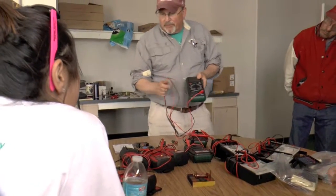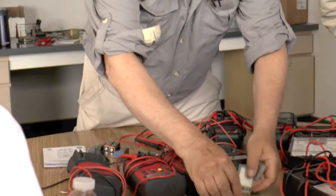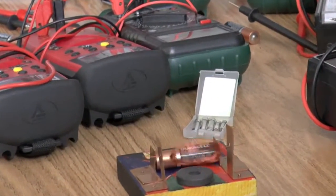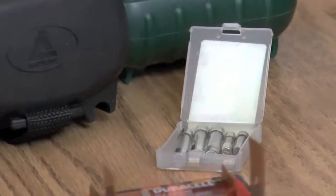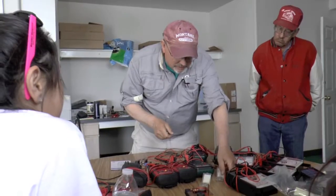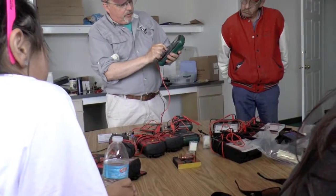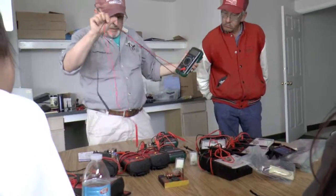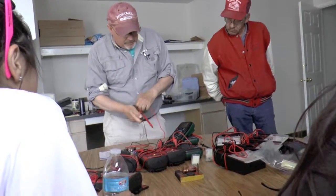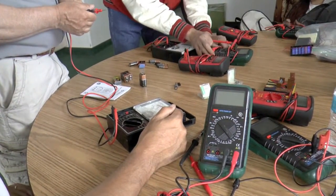You might ask, what do I need to know that for? Unless you're trained in electronics, you don't really need to. But consider fuses — they come in all different sizes. They've got the little colored ones in your car. Sometimes your windows won't roll up, you look on your car's chart and it says fuse number 18, 20 amp. You pull that fuse out, take your multimeter, set it on continuity tone, and you'll be able to tell if it's a good fuse or not. You can touch your leads together and measure across it to check for a bad fuse.